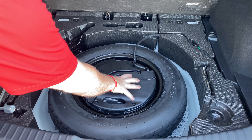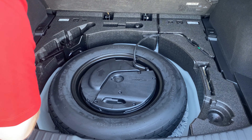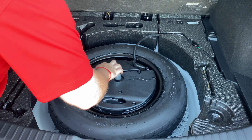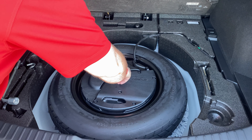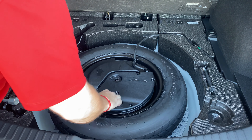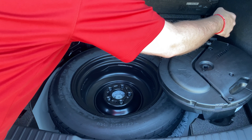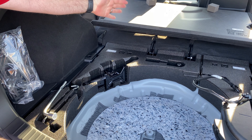So the first thing we want to do while we're back here is go ahead and remove the Bose subwoofer, which of course is the grand touring and higher, and then some equipped tourings. You'll notice that this has a bolt on it here. The tire tool fits there, and you just turn it counterclockwise until it loosens up. You can set it right over here, then grab this by the handle and remove it. You can unclip it here also to get it out of the way, pull this out and slide it out of the way, and remove the spare tire.